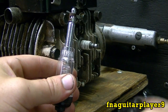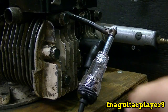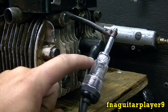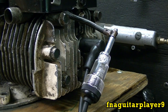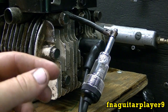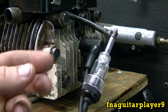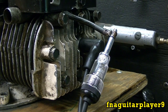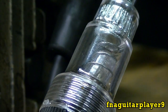Now I've got the plug in the engine and the wire unhooked. I'll hook the wire onto the inline tester and put it on the plug. If the plug is firing you'll see a light come on inside here. If you have a weak spark it's going to be real dim, and if it's not firing all the time — like if you have a points problem or a weak coil — it'll be intermittent. That's usually determined while the engine's running.